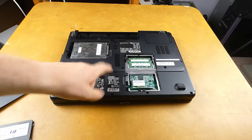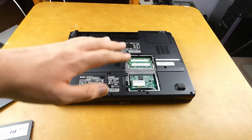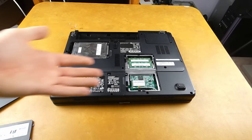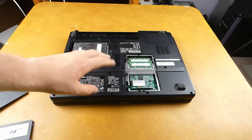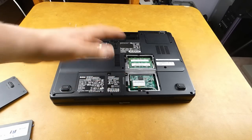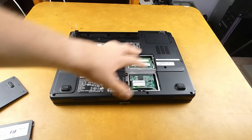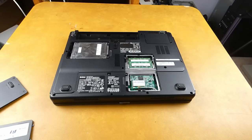What was also upgradable on most of these old laptops was the CPU, because CPUs were very rarely soldered to the motherboard. They were all socketed for the most part, just like on a desktop motherboard. So if you could find a faster chip and the BIOS supported it, you could upgrade it. Unlike the hard drive and RAM, though, the CPU was often buried and you'd have to tear apart the laptop a substantial amount to actually get to the CPU socket.